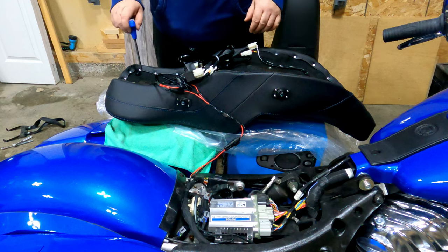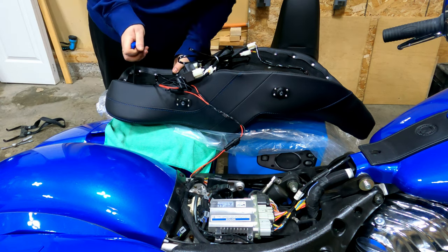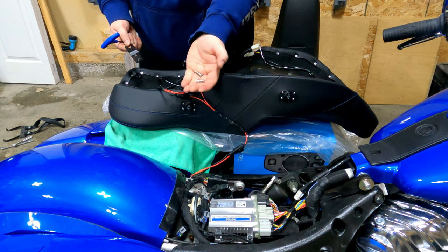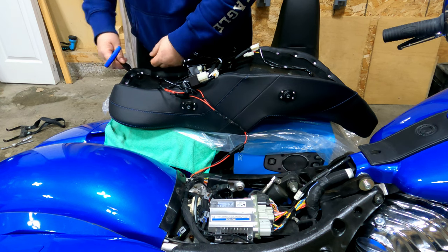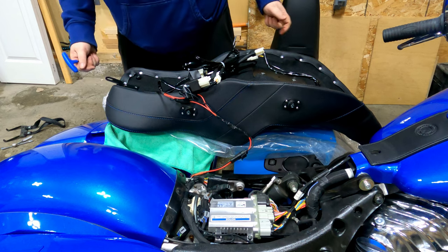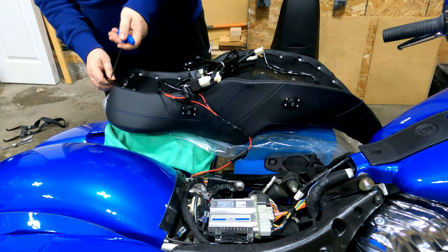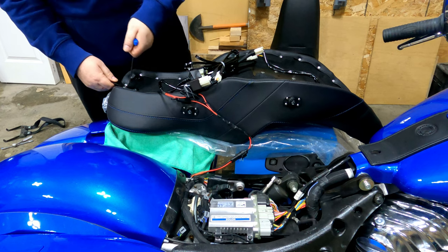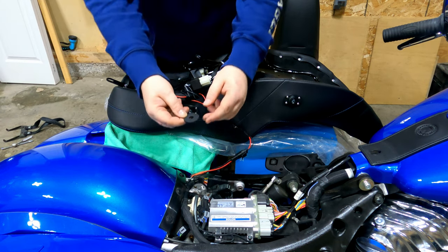One thing I forgot — before putting it on, you need to switch the mounting plate around. There are two four-millimeter hex bolts at the back. The plate gets shipped facing down so it doesn't bend or cut anything in transit — you just take the two screws out, lift the plate straight up, turn it around, and put it back down. For good measure I'm going to put a little blue Loctite on those. One thing I really like that Saddleman did is they included a rubber washer to go between the mount and the paint.